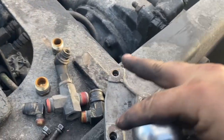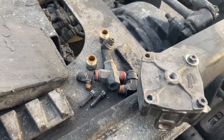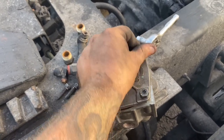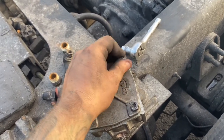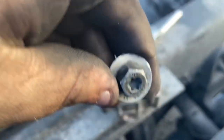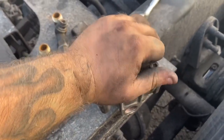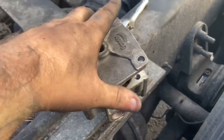These two bolts are what hold it onto the bracket and the frame. Let's pull these last two off and see what the damage is inside. When pulling this off, you've got to be careful — there is a spring in there, so it is spring-loaded, and if you are rebuilding it you've got to be careful not to lose anything. On this tag right here: RV055 — that's the style of brake valve we have. Recording with one hand while taking these off is a pain, but you pull to remove that pressure and take the top off.